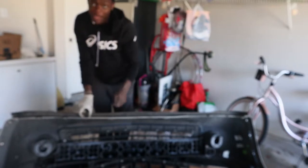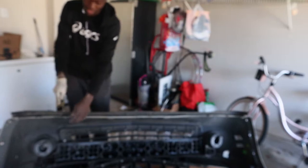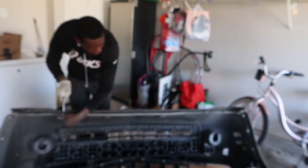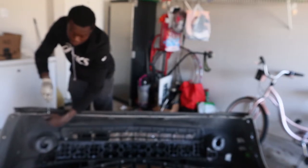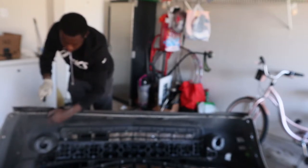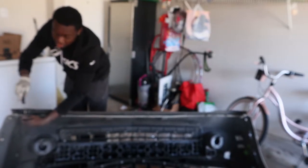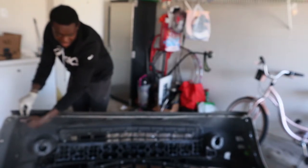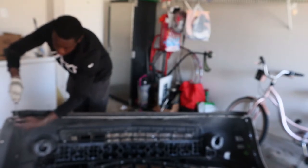I also noticed there is no opening for air for that cold air intake right down there at all - all this on that side is completely closed off. I could pop out the fog light housing since I don't have one, and I don't plan on getting fog lights for this car because I like the covered-up black look. But if I pop that out you can get more air more directly. The only issue is if it rains, but I think the thing may be a little bit waterproof.